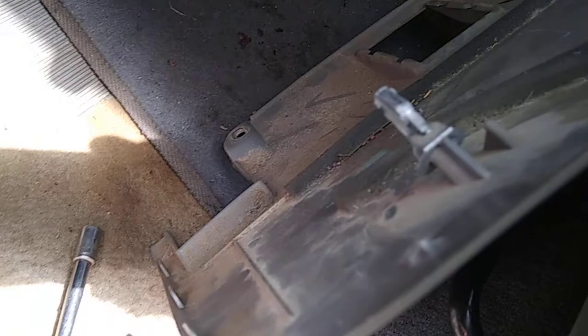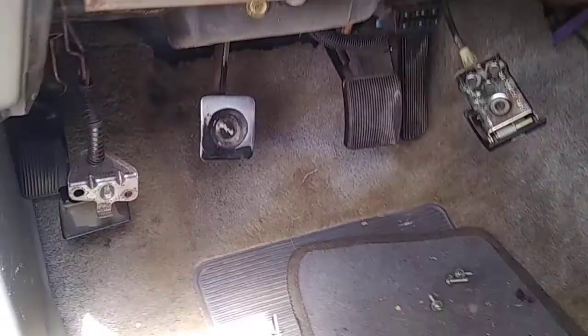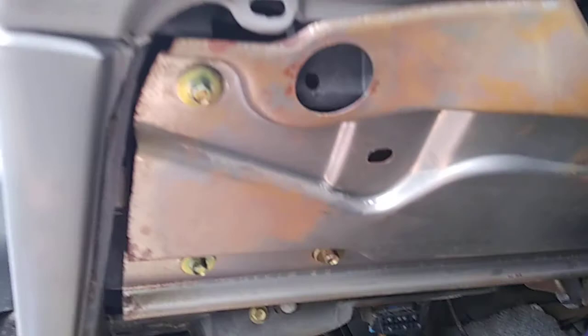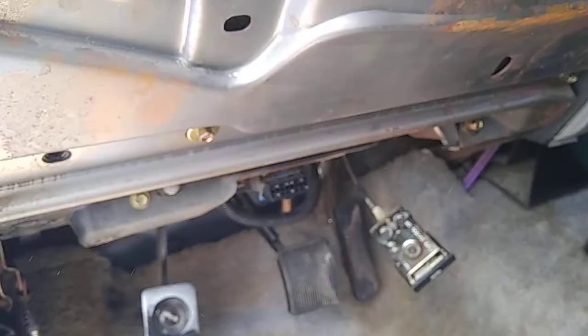Be very careful because yours may be dry-rotted. Last time I took this off, a little tab right here broke on me, but as long as these tabs don't break you're good — just pull it and it'll come off. Set it off to the side. Keep your bolts together so you know where they go. Under here these are eight millimeter — you've got one there, one there, one there, one over here, and one up here, and this panel will pull down.